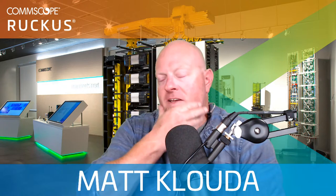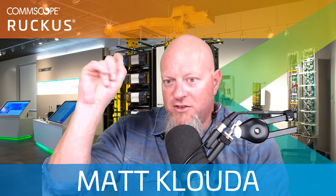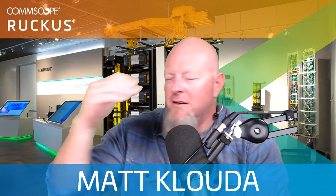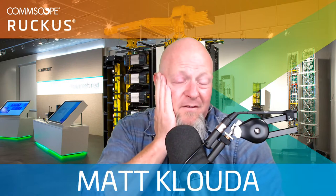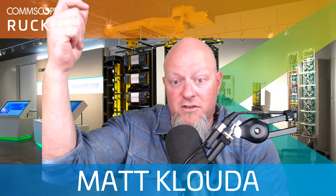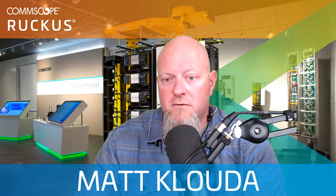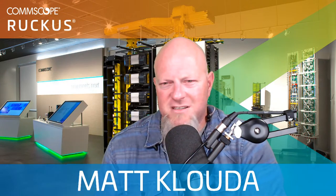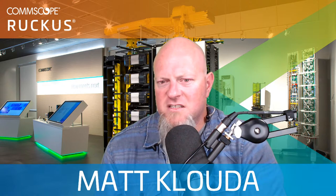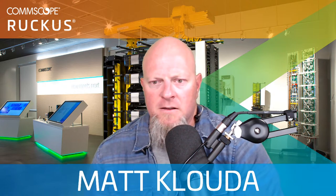It's really sensitive. I don't mean to belabor this point. That reset button is super sensitive. So when you hold it in, can you see the power light go red, and you count to, what did Anusha tell me to count to? 12, 15, something like that. Hold that button in as hard as you can and make sure it stays depressed for 12 seconds and then let go of it. You just went through the reset, but it's still not showing the WLAN. That's really odd. That doesn't sound right to me. I'm starting to wonder if you have an access point that's faulty.